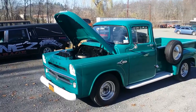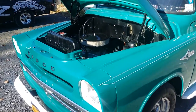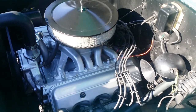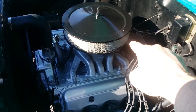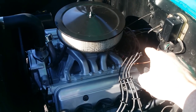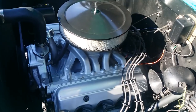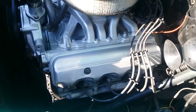Motor is all done and runs absolutely fantastic. We replaced the water pump, the oil pump, the fuel pump. We took the distributor all apart, took the points out, put an electronic ignition in it, went from a 25,000 volt coil to a 50,000 volt coil. With the pickup in the ignition system, we're doing a multi-spark setup with a rev limiter in the original distributor with the original style cap.